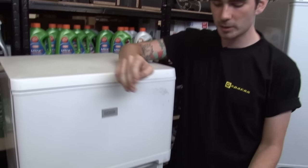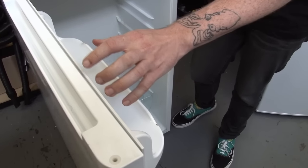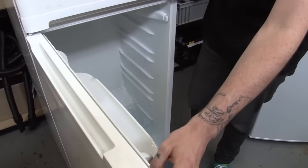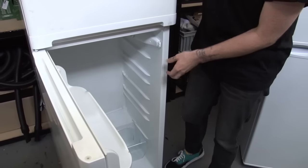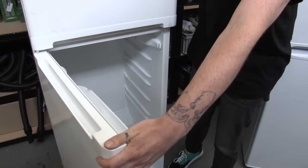The first thing you'll need to check is your door seals. Are they dirty? If they are, give them a clean, because if there's food and detritus built up on the door seal it won't form an effective seal with the fridge and so condensation can leak.